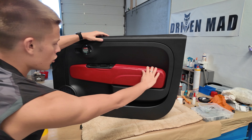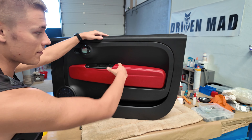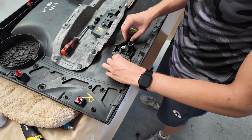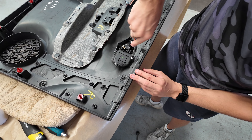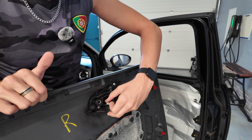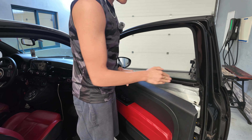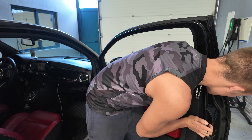We'll head back over to the car and get it on to see how different the black looks - at the moment it looks pretty good and very similar to the car. Before we get the door card on, we're just going to put the door handle mechanism back through - the chrome bit goes in and slots over there, then gets screwed back on. Mechanism is back in. To get the door card back on, there's a little clip here which slots in and goes down, then you push the clip on top. The top hooks on and we work our way around pushing the clips in.